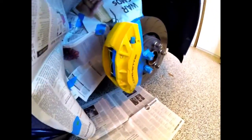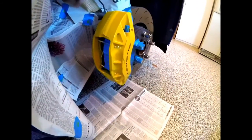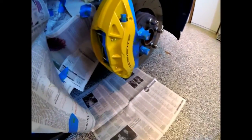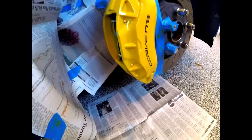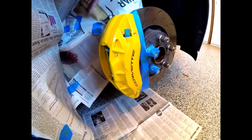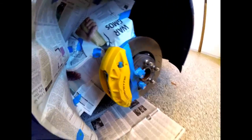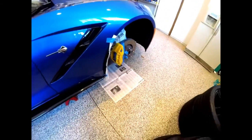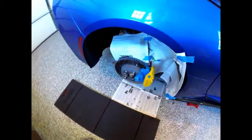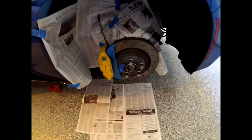I'm going to try something I didn't see talked about anywhere else — I put a couple of little wooden kitchen skewers through the holes that the pins go through, to keep paint out of them. There's probably other ways you can do that, like just painting over it and popping a drill bit through when it's dry. Also, it helps a lot to be in a temperature-controlled garage, because it's about 40 degrees out right now.